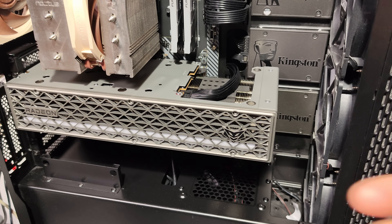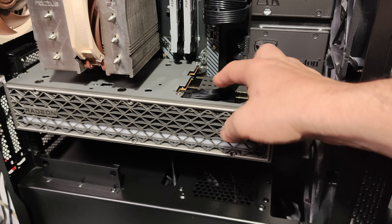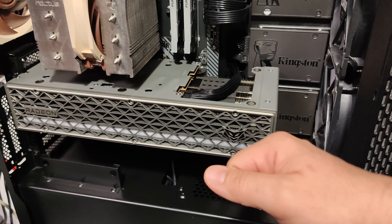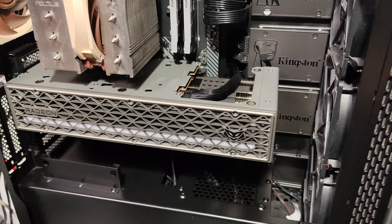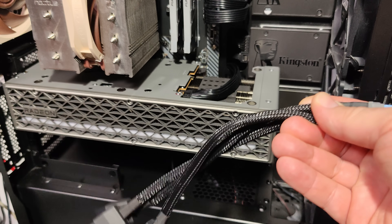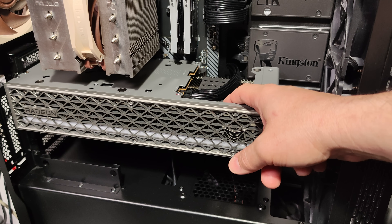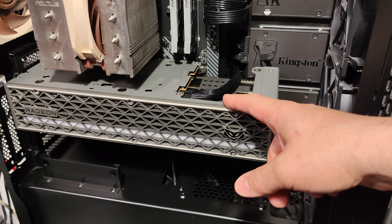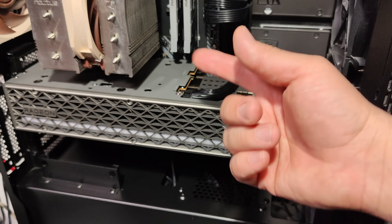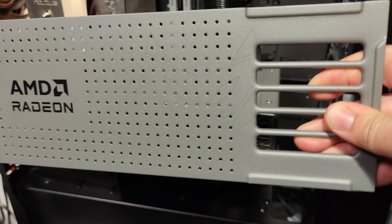Let's recap: you have a forced connector because the cable doesn't go in nicely, putting a lot of strain on it and always pushing it slightly sideways. You can use the included cable as an improvisation but add more connectors and the cable will flex out. You also have a foam pad covering the fins, reducing cooling efficiency. So there is nothing great about having this hidden connector and using that 12-volt connector.